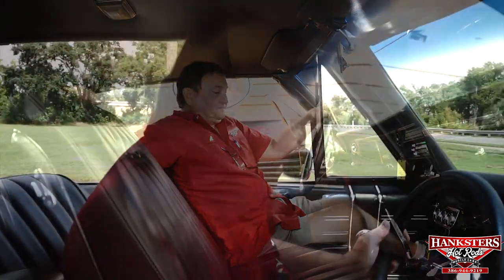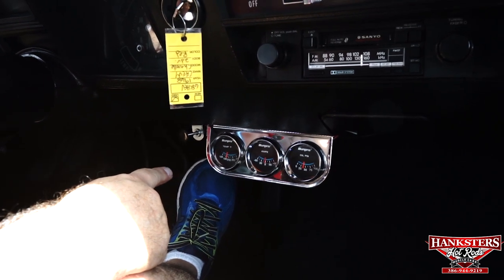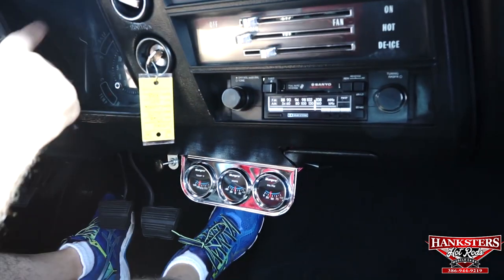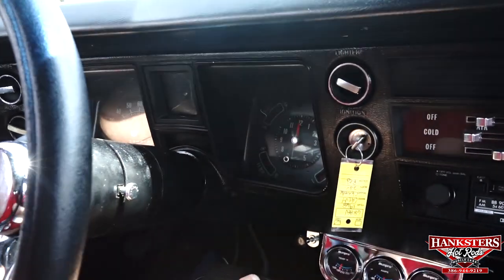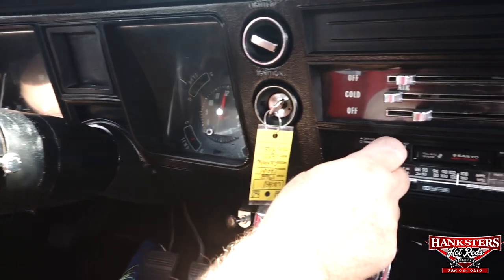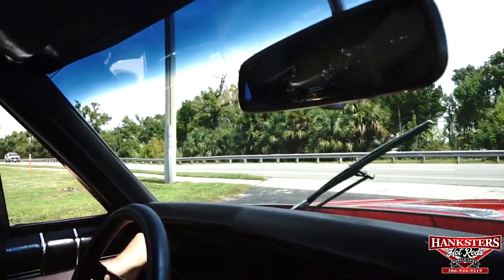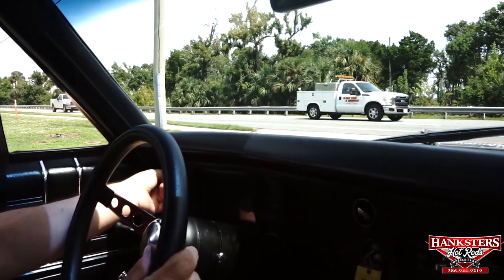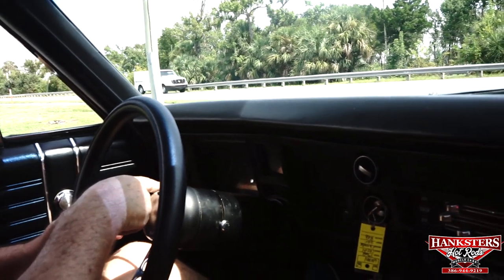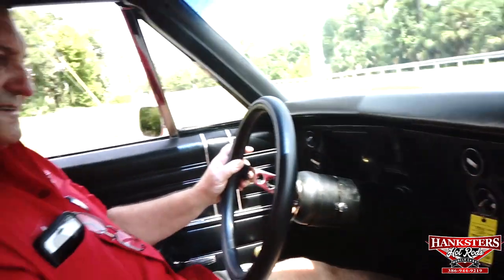Let's see what we've got working. The gauges are definitely functioning — temperature is coming up to operating temperature, the amp gauge is working, and the oil pressure is also working. The factory quadrant gauges are functioning; the fuel gauge shows half a tank. The other dash gauges are not active since they've been transferred to the under-dash unit. The clock isn't working. The radio is working. The wipers are working. The horn is not working. Left turn signal is functioning. Right turn signal is functioning as it should.